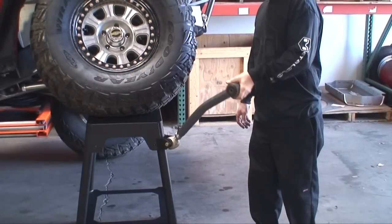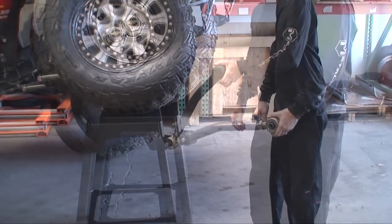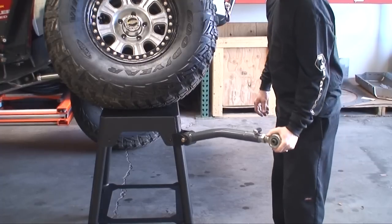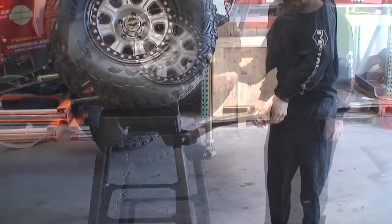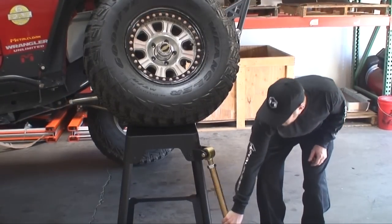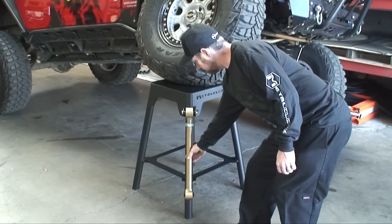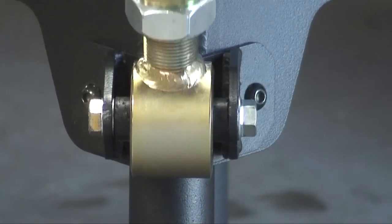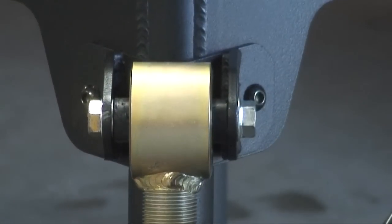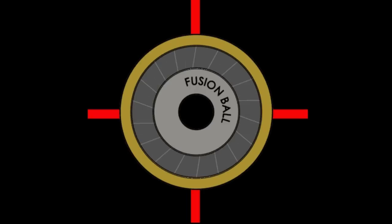But what about full movement, or macromotion? The ball and cup flex joint has excellent macromotion but exposed wear surfaces still exist, whereas the OEM style bushing has limited rotation and no wear surfaces. Metal Cloak's DuraFlex joint has full macro rotation with a very large, durable wear surface. The synthetic grease in the outside grooves provides all the lubricant needed for long-term use of the joint. The animation shows that the DuraFlex joint begins rotation with flex-diffused elastomer, then breaks free to act like a large surface bearing.